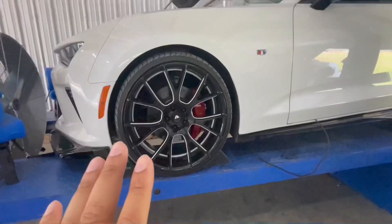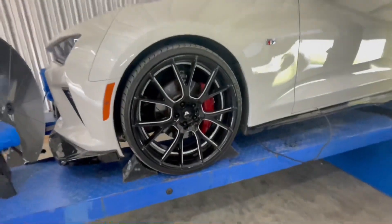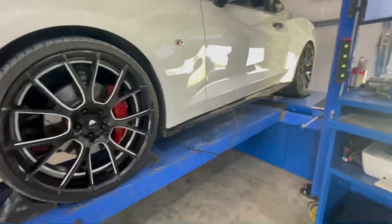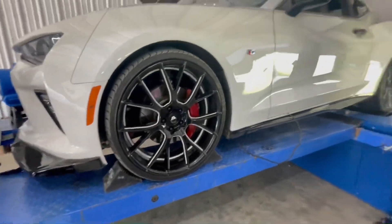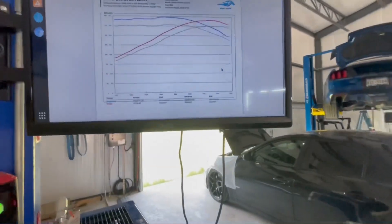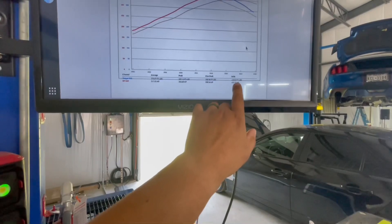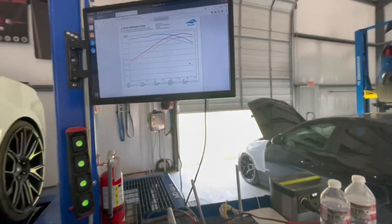With the trans tuning it is going to help. This customer does have some large 22-inch wheels on here — she's getting more into the drag racing scene, so she's got another set of wheels and she's going to go down to 20s and eventually get a drag pack. The dyno is a little lower than some other cars, but the A-to-B comparison is what we're worried about, not necessarily peak horsepower. So we gained 32 horsepower and 38 foot pounds of torque from a Rotofab cold air intake and a flex fuel tune.